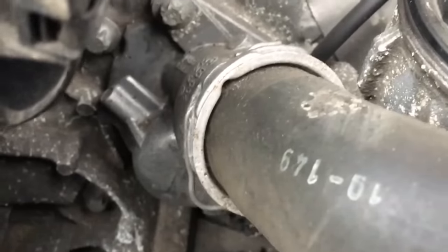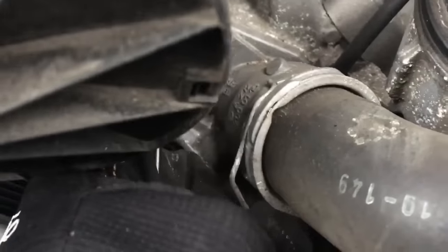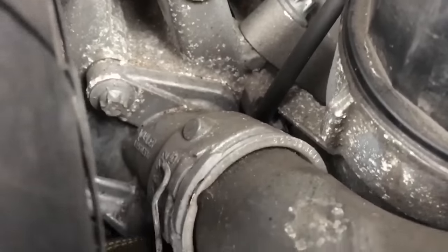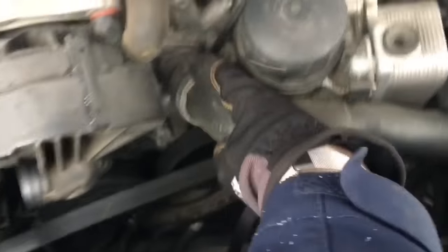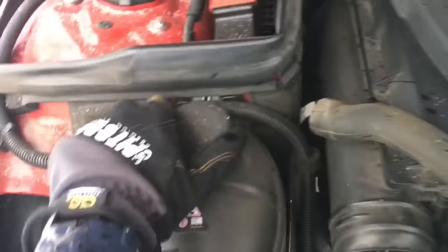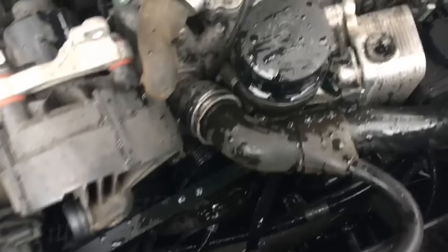This is not a typical radiator hose — this is a late model German quick disconnect. So grab a pick or some other sort of implement, and gently work that clip off, or at least out of the way enough where you can release the hose, and then carefully separate it. If you've just been running the car, undo the coolant cap first to let off the pressure, otherwise you'll make a little bit more of a mess here.